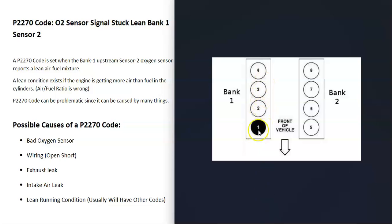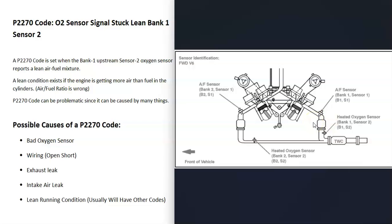If you have a V6 or V8 engine, you're going to have two banks. Bank one is always the side of the engine with the number one cylinder, and the opposite is bank two. If you just have a four-cylinder engine, you'd only have one bank. It can be a good idea to get a diagram of where all the sensors are located on your particular vehicle — for example, this is a 2007 Camry with the 3.5-liter V6, and right here would be that bank one sensor 2 oxygen sensor.